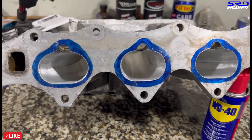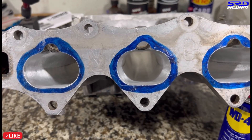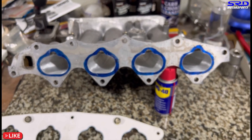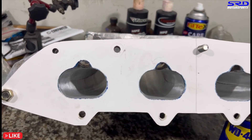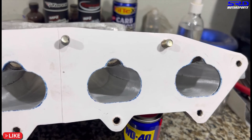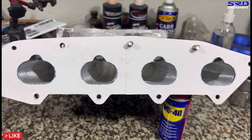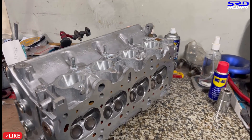After washing up the intake manifold, you can see it's all cleaned up — fully ported from the runner entry all the way to the intake flange toward the head. With the intake gasket on the intake manifold, if you look close, there's no more ridge, no more line that we scribed — it's gone. So it's actually port matched really well. This intake gasket is perfectly matched to the head, and we used it to match the intake manifold.